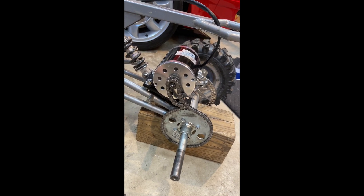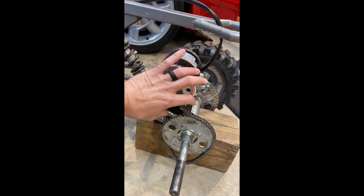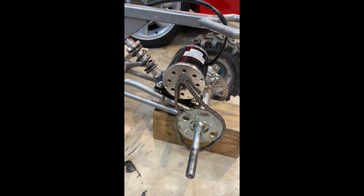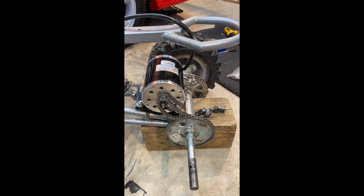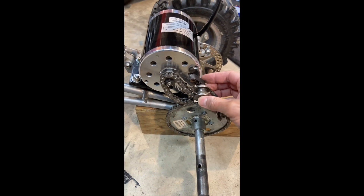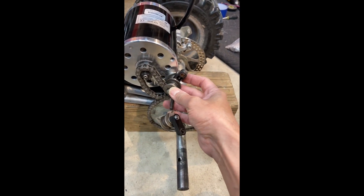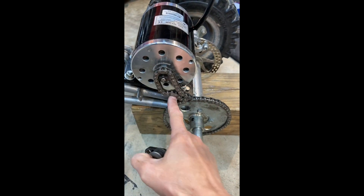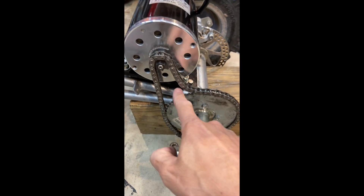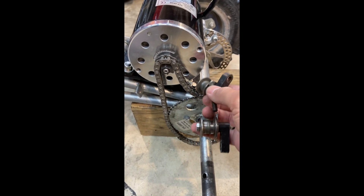The chain is obviously too long and needs to be shortened. I'm going to try to fab up the chain tensioner as well, though I may need to build another bracket to hang it in the right location. Looking at the stock chain tensioner, it just doesn't look like it's going to work. The motor housing is so big, and with the larger sprocket, there's just not enough room where there was before.